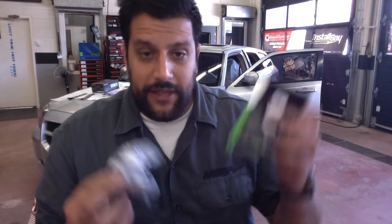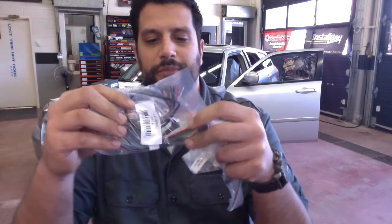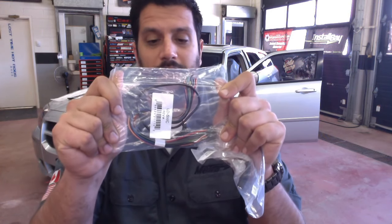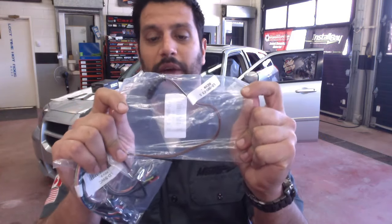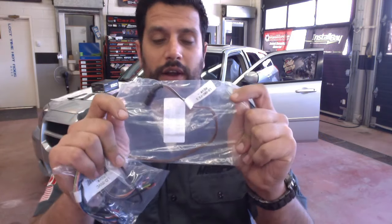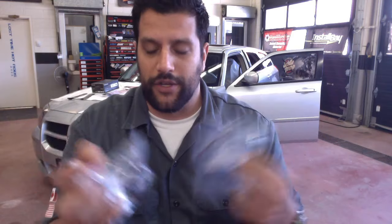The third thing you'll find inside the box is the two wiring harnesses. One hooks up to your radio harness or interface depending on your install. The other is the 3.5mm SWC jack. Depending on which radio you're doing, you'll hook up either the brown or the brown-white wire to your radio wiring harness, allowing you to integrate your factory steering wheel controls using the AXSWC.